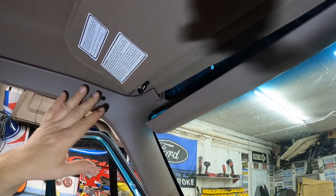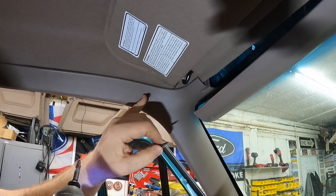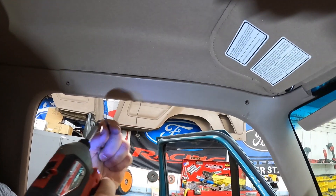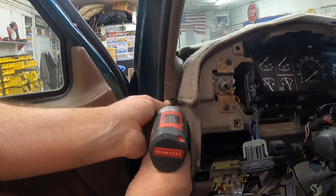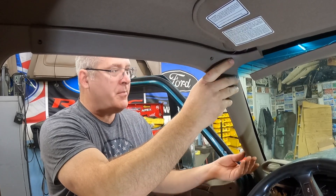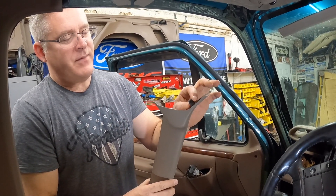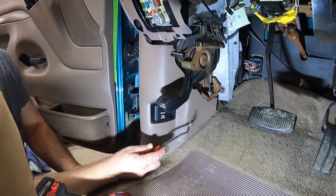The next step will be taking two screws out of the top of the A-pillar trim. The previous owner covered these with some butyl rubber to keep them from rusting and probably to keep the trim from vibrating. The third screw in your A-pillar is longer than the other two, so set this aside. Now you'll simply remove your A-pillar trim and slide it out. Be careful — it's brittle plastic. Make sure you don't break the tab and check it for cracks. Some of these mounting bosses have felt on them — it's a good time to replace that to keep it from vibrating and squeaking.